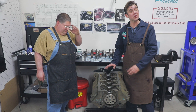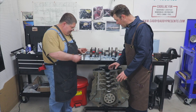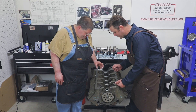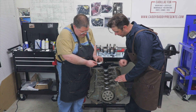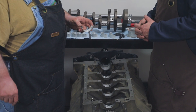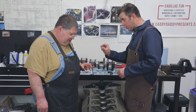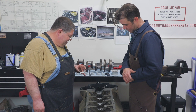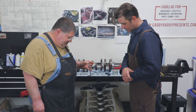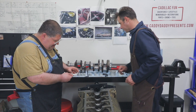The next part of our engine assembly on the bottom end is getting the crankshaft in. First we're going to fit our bearings and drop them in — they're directional, with oil passages, so you'll see which direction they want to go and the index tab fits into the recess in the block. We'll set the bearings in on the block side, set the crank in, lay some plastigage to measure the tolerance and clearance. Once that's checked out we'll pull the crankshaft back out, put assembly lube on everything, put the rear main seal in, and button this bottom end up.